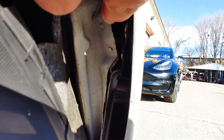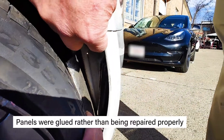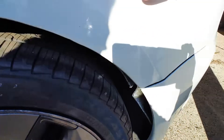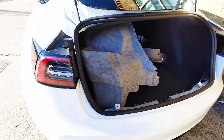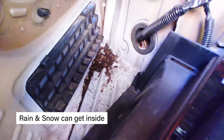You can see on the inner where it's not sitting properly — the seam is split open and the bumper isn't sitting right. Looking inside, you can see where it's been glued rather than properly repaired. This panel should have been replaced instead. Inside the trunk, the seam is totally wide open — water, snow, and rain can all get inside.